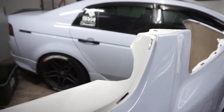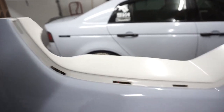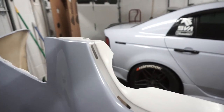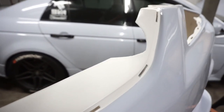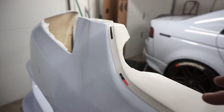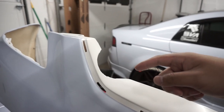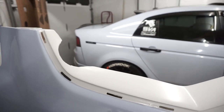The centerpiece is cut off — here it is on the ground. I used the Dremel with the cut-off disc. Make sure when you guys cut this to wear a mask, because you definitely don't want to be breathing this in — it gets really dusty. If it's fiberglass, obviously, and if you're on the OEM bumper you're just going to be worried about pieces of hot plastic shooting back at you, so be mindful of that.